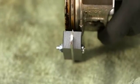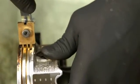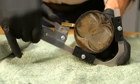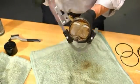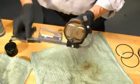Next, line up the tool guides with the second ring groove like this, and slide the adjustable handle until the brass bit engages all three grooves and clicks in place. Grab the tool like this and turn it counterclockwise around the piston five times until most of the carbon in the grooves has been removed.